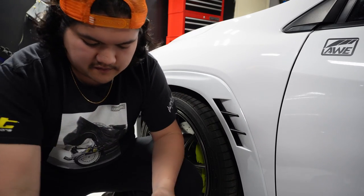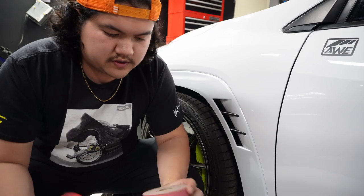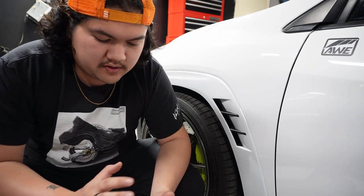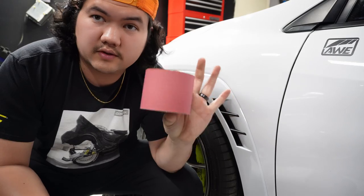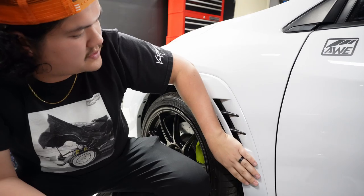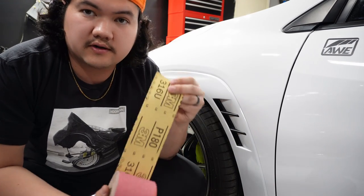Anything ranging from 150 or coarser to probably somewhere closer to like 1000 grit for a really smooth finish. But I've absolutely done it with just 180 grit on the primer and then paint, and it looks perfectly fine — actually that's what I did with these. Nothing finer than 180 grit was used.